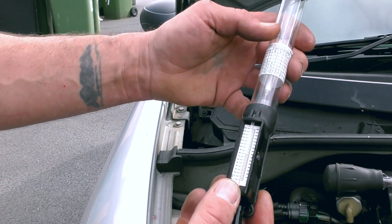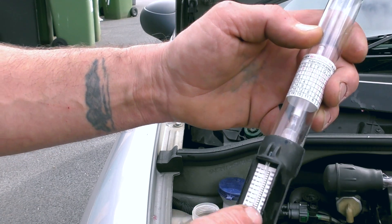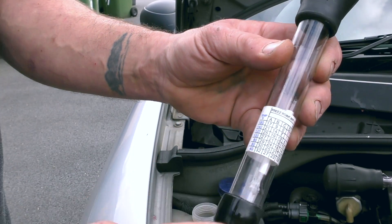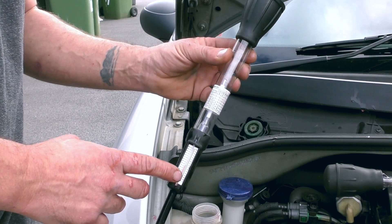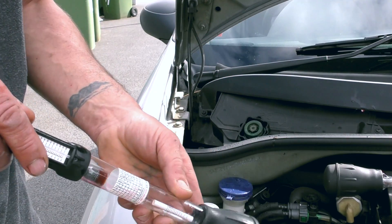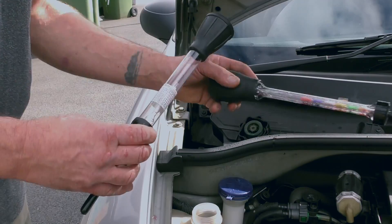The third one here is the one I prefer, actually. It has a thermometer for working out how warm the solution is, and then it measures specific gravity - you have the degrees in Fahrenheit on this one and the floating float. You measure the temperature and then see how far up the float goes, and then you check it against the graph. It's like a wine tester for specific gravity. Fluid at different temperatures acts differently, so you get a more accurate reading.